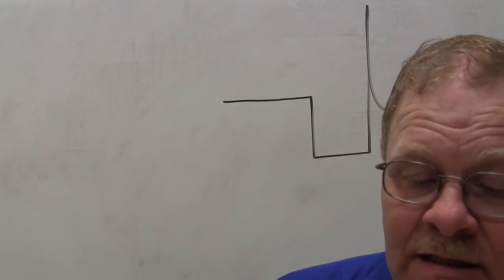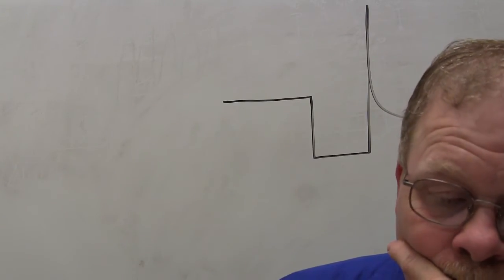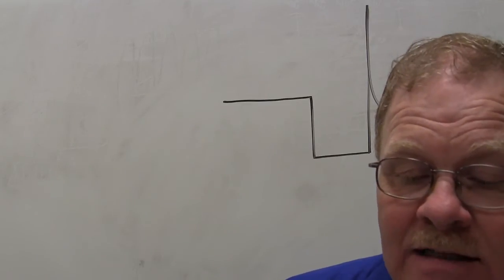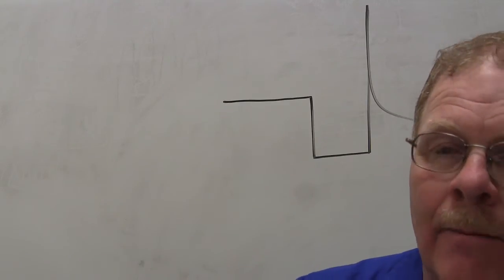How many times must the ignition switch be cycled on to put a Chrysler into self-test mode? Actually, 3. They don't even have the right answer on here. If you want to put an older OBD1 Chrysler in there, bam, bam, bam.